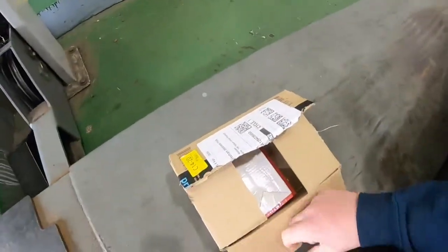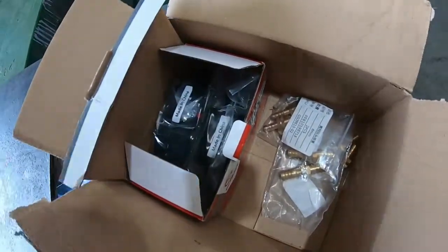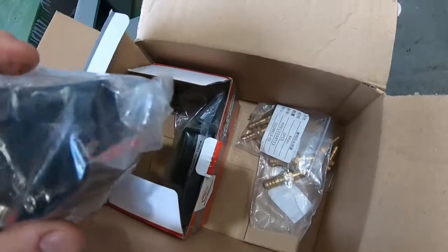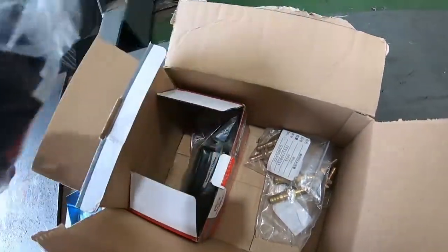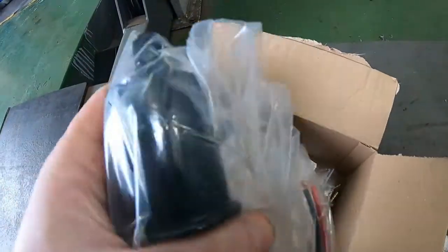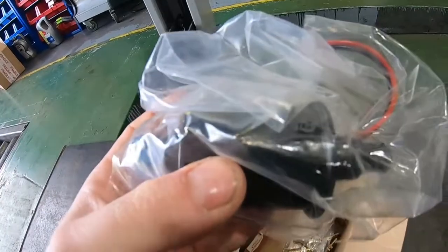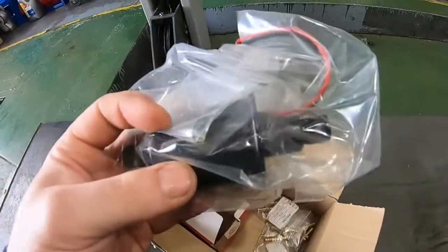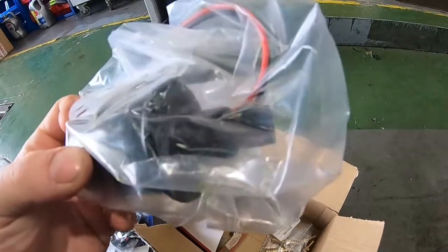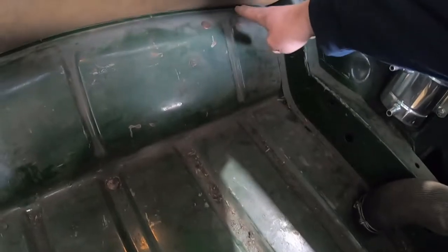So I went with another option, thanks to Mr. Amazon. This is a brushless pump — there's a mounting bracket and loads of bits of fuel pipe and clips. This should be able to lift from much higher up and it'll be a lot quieter. My idea is I can mount that pretty much anywhere within, I reckon, about 30 centimetres above the bottom of the tank — which brings us to about here, on any of this metalwork on the chassis leg.